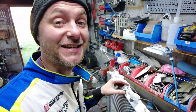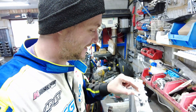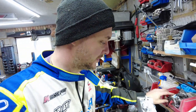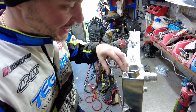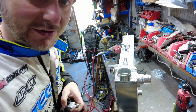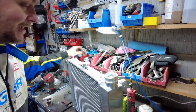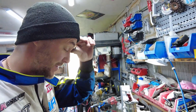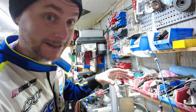The joys of Amazon — all race cars could be built on Amazon. I mentioned the first filler neck was too small; next-day delivery and here's the bigger one. This one fits my original cap. I picked this side of the radiator because it's a little wider. I'll raise it slightly with a short pipe section, then weld the filler neck cap on top. That feeds directly from the radiator, eliminating any need for a separate expansion bottle, extra plumbing and extra weight.